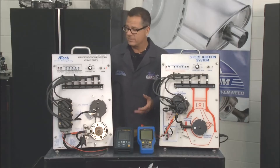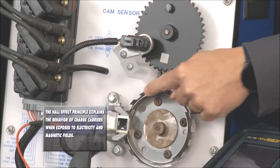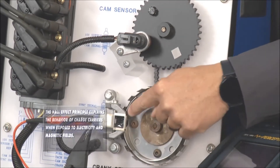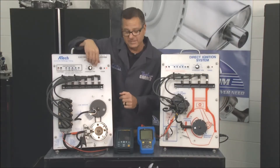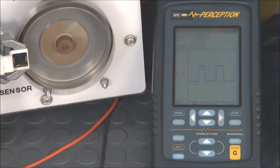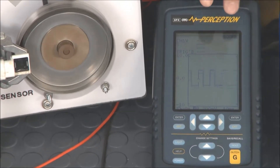I've got one right here on a board for you guys to see at home. This thing down here is the crank sensor. The crank sensor picks up these little teeth as it goes around on the crank and actually interrupts with the little slit right here as it goes through there, turning on and off a DC voltage. If I fire this up, you can look at our oscilloscope — the pattern is on, off, on, off. The faster I go, the faster and tighter the frequency gets.